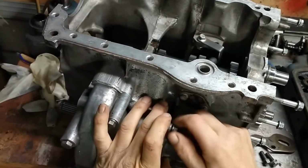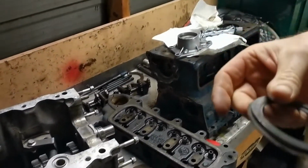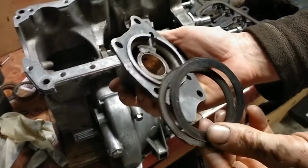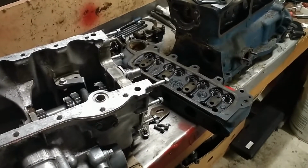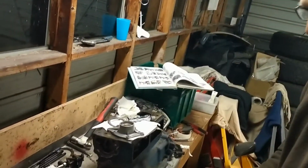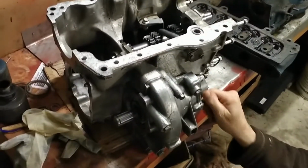So you mount this side on, and then on the other side you have to work it out. I think it's a three-thou preload, so you shim this side before you put the cover on. As you put the cover on, it gives it a three-thou preload to squash the bearings up so nothing's loose in there on your differential. But you have to work that all out. You put the end cover on. MED's a place to go. They show you exactly how to do it. Really good tutorials on there, so just follow that. And yeah, as easy as that really.